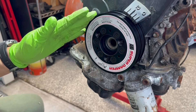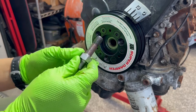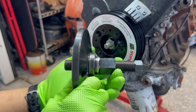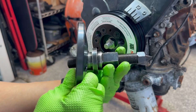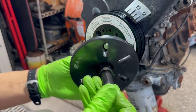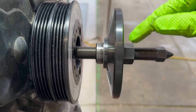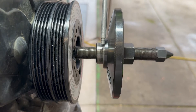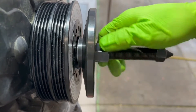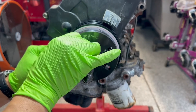Removing the ATI Super Damper is very simple. Remove the three center Torx T40 Plus bolts and then install your crankshaft adapter by hand, bottom it out and just snug it by hand. Now we're going to change the configuration of the tool — take the base plate and flip it around so it sits like that. Then install the center shaft onto the crankshaft adapter and rotate it clockwise until it bottoms out. Now rotate the drive nut until it almost touches the surface of the ATI Super Damper. Rotate the base plate so you can mate the 5/16 inch bolts to the open threads on the ATI Super Damper.